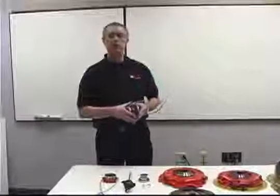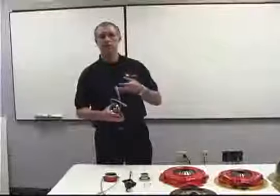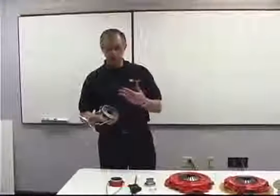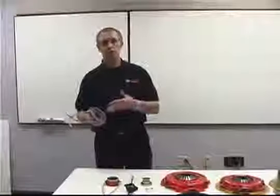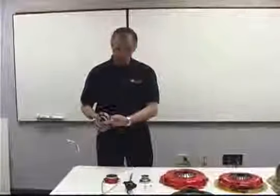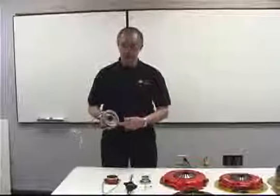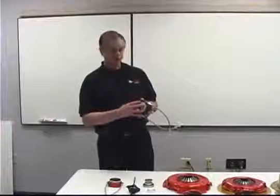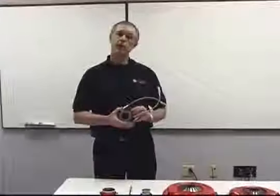It's just like changing the collar on a Muncie to a T10. You can't take a collar off of a Muncie and put it on a T10. No more can you put a hydraulic bearing from a Muncie to a T10. So it is transmission specific because the back of this is machined identical to the collar. So what you do, and this will give you more clearance, this is what you would use on Chevrolets because they use a 4-speed bell housing. It's not deep enough. And then also on the early Ford 4-speeds, your top loaders and your T10 transmissions that were used in the Fords.